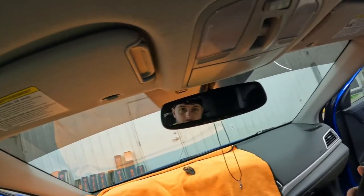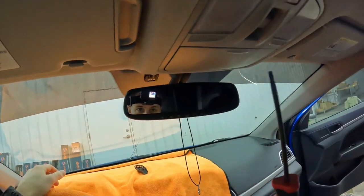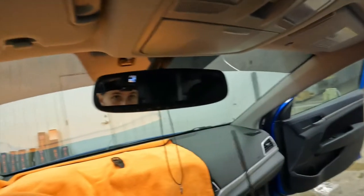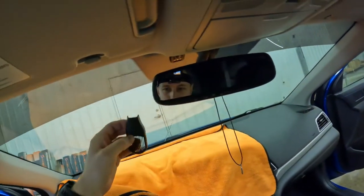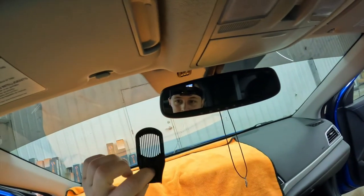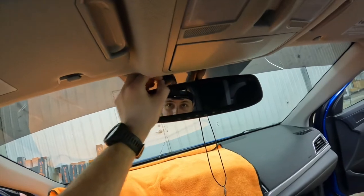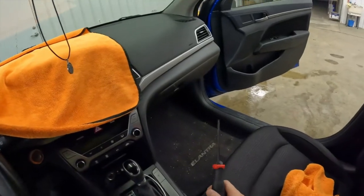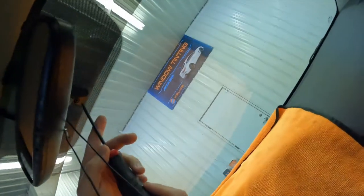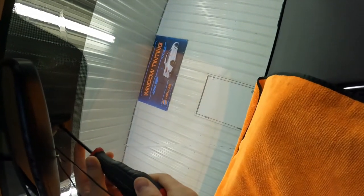This isn't exactly where it's going to go — we haven't measured it out or anything. If you watch the last video, we basically just cut the excess off of our back window, and this is what we're left with for a strip. It's going to go down a little bit lower. But first, on this particular Hyundai Elantra, we have some kind of sensor. I'm not really sure what it is, but this little plastic cover goes up here — you just gently pry it off and put it somewhere safe, like in the cup holders or cubbies. On this particular model we also have a T20 Torx screw up here.